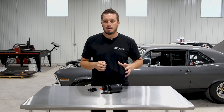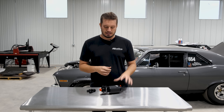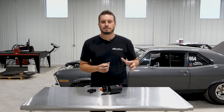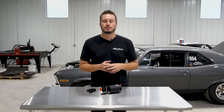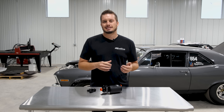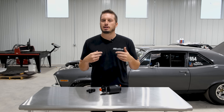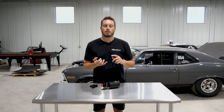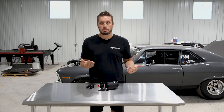One of the reasons why that's a problem is because, as I covered in previous videos, this Magnafuel 750 loves to have excess fuel on the backside of it on the inlet, which means on this pump we try to put a number 12 fitting to it. You can get away with the number 10, but performance isn't the best. So when somebody adds a second pump, a lot of times they'll take that original 12 and just Y it into the back of two pumps. Now you have two pumps starving for fuel — not only bad from a performance standpoint, it can cause cavitation and starvation, which can burn up a pump prematurely.